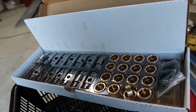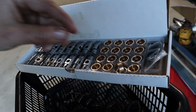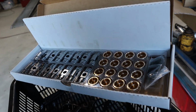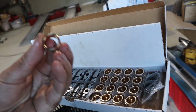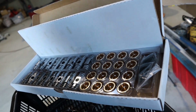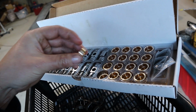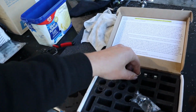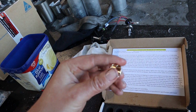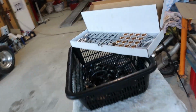If you've only got a mild cam, you don't plan on giving your engine a real hard time, these are going to be fine. But you know, if you're putting in something that's fairly wild, like I had put these in my drift motor with this same cam that we're putting in this LS2, but I had expected that I would pretty much be buying replacement bushes to do replacements every 2 years or so. I expect that. So because these are pressed and they don't move around, what you end up having is wear on one edge as well. Whereas because the CHE ones actually move in the rocker arm and in the trunnion, you get a much more even wear because they actually move around while in operation. So you get much more even wear as well. So those are the main differences. I just thought I'd show you before I put the last one in.